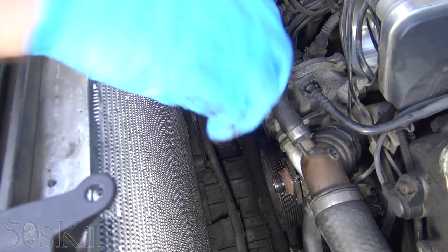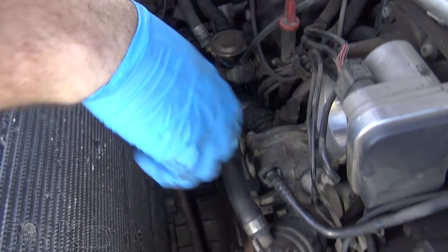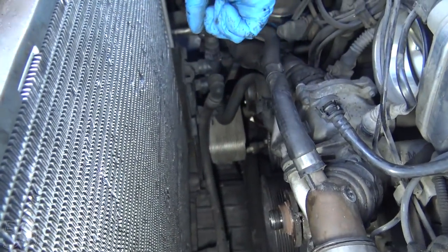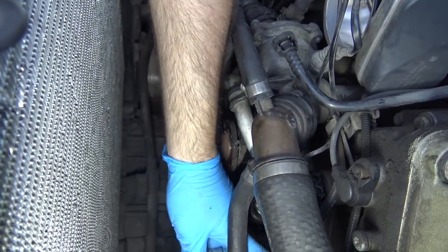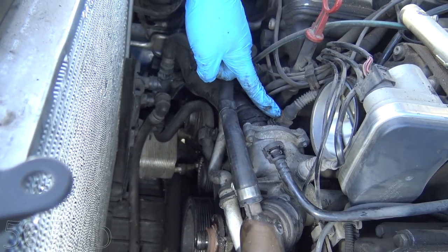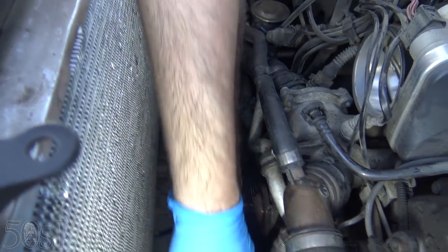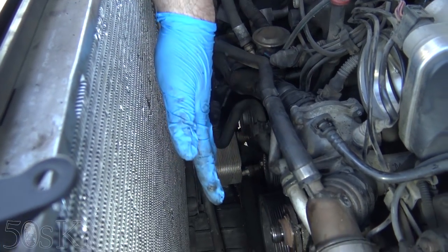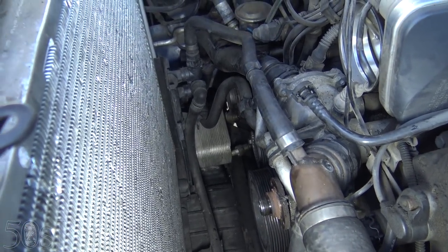You've got to get something to pull that off. Basically all we need to do is take this coolant hose off, take this coolant hose off, and because I want to take this up and move it out of the way — this is actually attached permanently to this hose here — I'm going to detach it from down over here, and also down from here. That's going to peel back. I'm going to disconnect this connector and this connector here, and then we have this crossover pipe. There's a bolt here, there's a bolt down here, there's a bolt down on this side. We're going to take those loose, pull that crossover pipe out, then we'll be able to unbolt the water pump and take that out. So that is the procedure. Let's start with down over here.